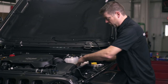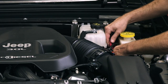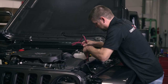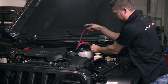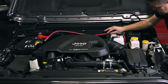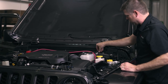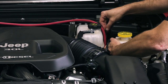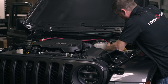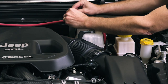Now back up top, we're going to reach our hand down in here next to the fluid reservoir bottle, grab that slack that we pushed up, and route it right up through here — pulling all this slack up. Then we're going to go over the top of this fluid bottle to reach our battery over there. I want to keep this wire away from our steering column that's turning, so I'm going to use a couple of zip ties on this line right here to keep it securely away from our steering column. Then I'm going to put another zip tie up top here on this little bracket just to hold that wire in place.